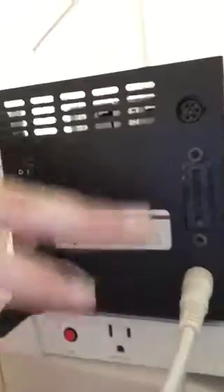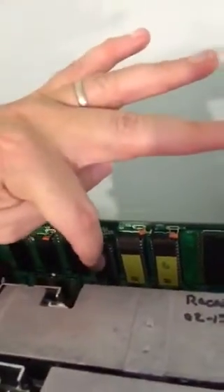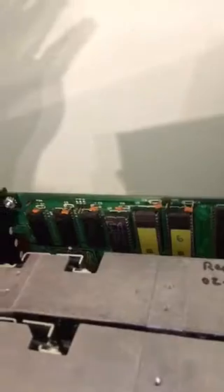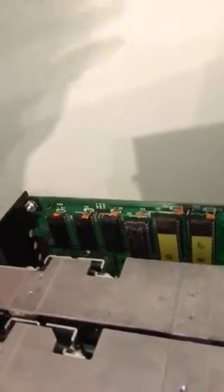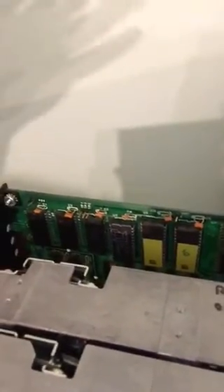Here are the serial ports — there are two of them — and there's a fused power connector so you can rapidly change a fuse. Getting into the nuts of the upgrade: you can see in yellow those are the two new ROM chips I replaced. The other thing that comes with the upgrade is this RAM upgrade — some RAM being added to the drive. Even the 1541s came with very limited RAM, though they did have a 6502 processor that could address up to 64K.